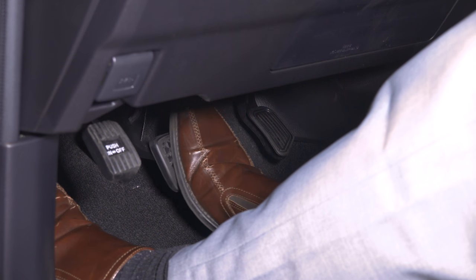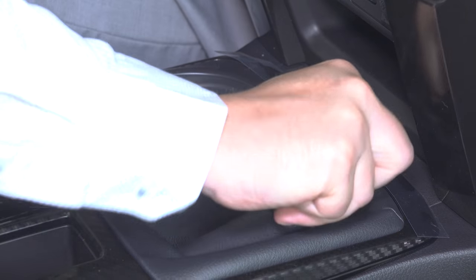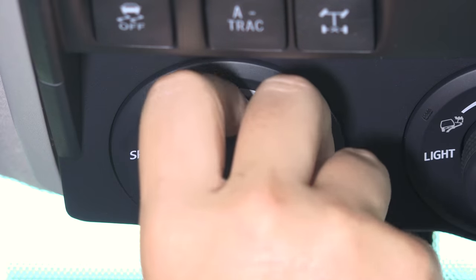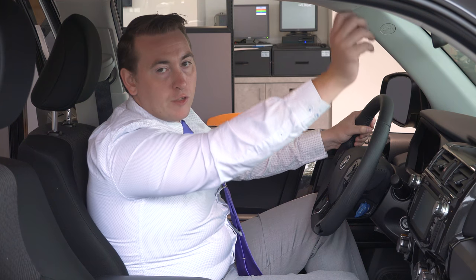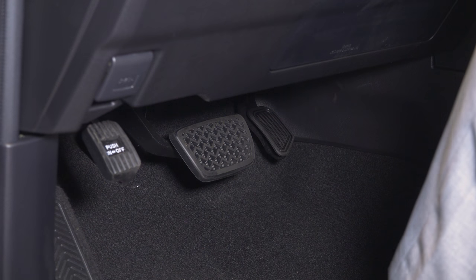To use the crawl control feature, all you have to do is simply put your foot on the brake and put the vehicle into neutral. Then the driver is going to shift the transfer case of the four-wheel drive system into the low four-wheel drive position. Then we're going to move on up to the crawl control button itself and turn on the crawl control feature. We're going to select one of five different speed settings — speeds can be set up to five miles per hour. Then we're going to remove our foot from the brake or the accelerator pedal completely.